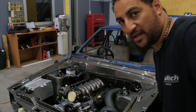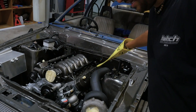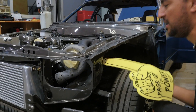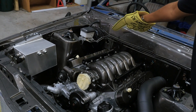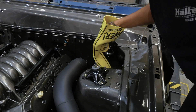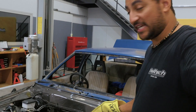In the car I'm going to try and route the boost control solenoid through the fender just to try and keep it away from all the heat of this dump pipe. We've got to protect the wiring, so we're going to try and run it underneath here. There may also be some other body wiring coming through here at some point because the owner has requested we keep everything clean and neat. The fuel pressure and flex fuel sensor — I might try a sneaky way of running it through the inner guard to make it nice and neat. We're trying to keep everything away from the heat, and there are different ways to protect wires from it, but we can figure out the best solution for this installation.